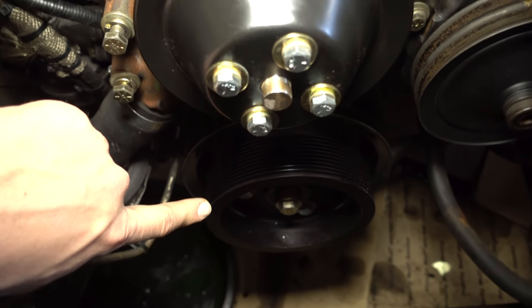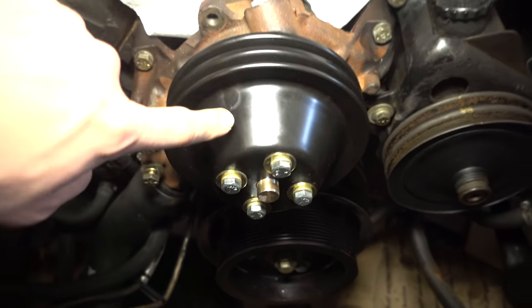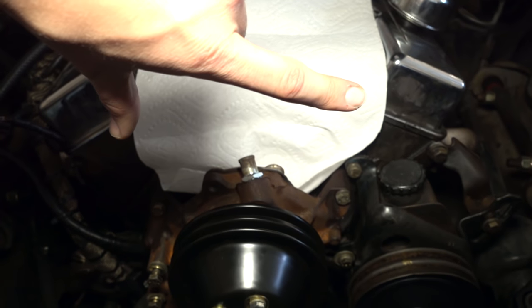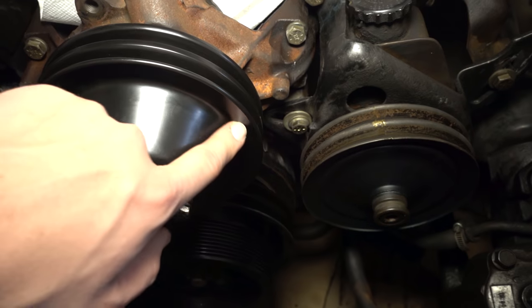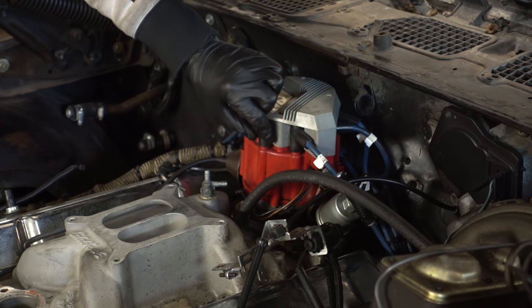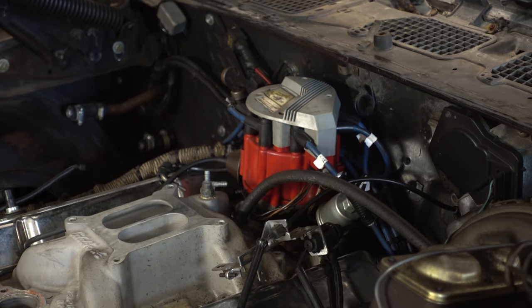Another concern is that this is a six inch pulley, this is about a six and a quarter, and the supercharger assembly up here with the idler and the driven pulley is about seven inches across. So that belt coming down is going to be getting pretty close. First thing we're going to do is remove the coil cover from the distributor, unhook the wires here and just let them hang over the sides, and then remove the entire distributor.